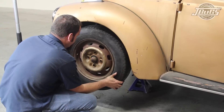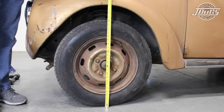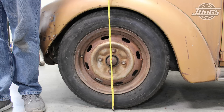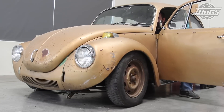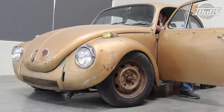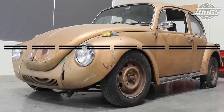The wheels can be installed, the car jacked up off the stands and lowered back to the ground. Before installation, the fender sat at about 28 inches tall and now sits near 24.5 inches. Seeing as our front end sat so tall originally, even with the drop we still have plenty of clearance for the stock 165SR15 tires. The front end may settle more once driven, so take that into account when lowering the suspension. Settling may be more drastic with new springs.